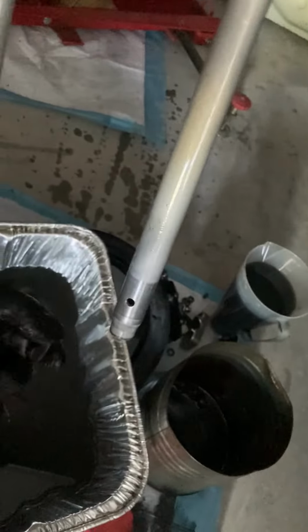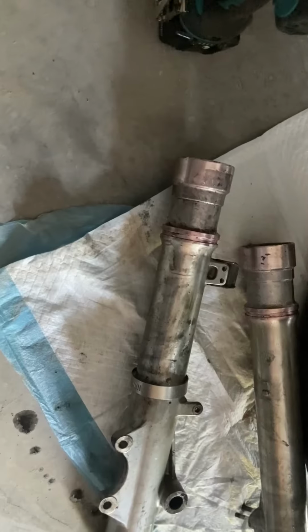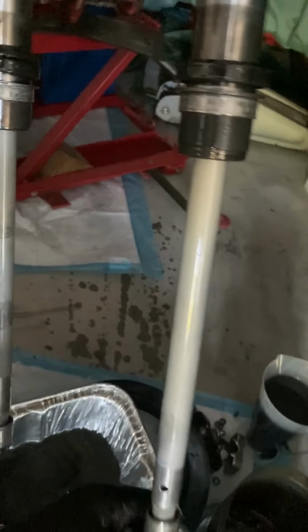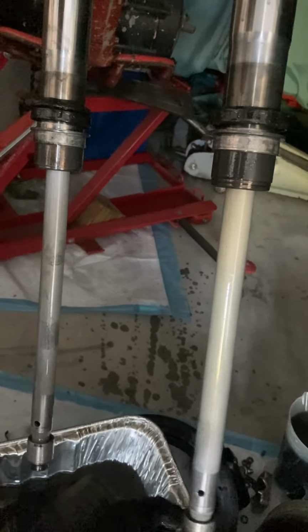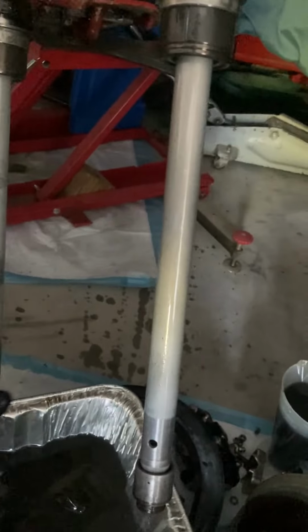As you turn this nut, the entire bottom of the fork is free to turn. So it's really important that you use some sort of an impact gun. As you hold this bottom part on here, you can impact gun that off the bottom. Otherwise, you're going to have to try to find some way to force to hold that bottom part while you put torque on this. So impact gun's the best way to do it. After that, I'm going to just completely rebuild this one.